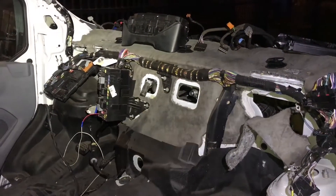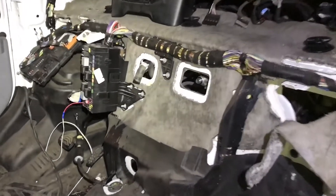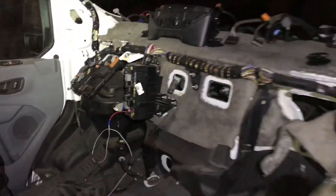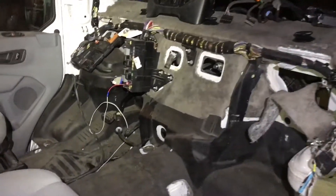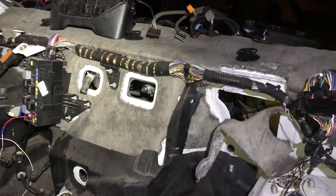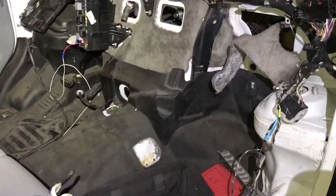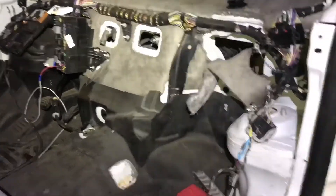I was checking this heater box right here — the heater box was sitting right here in the van that I'm fixing, not the parts van. There was a bracket broken, so I'm trying to use some epoxy glue on it to weld it back in place. Also, the drain hole tube that goes to the outside for the AC condensation — that one broke as well. I'm trying to fix that tube.